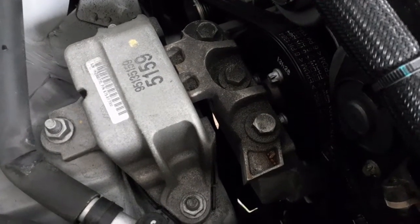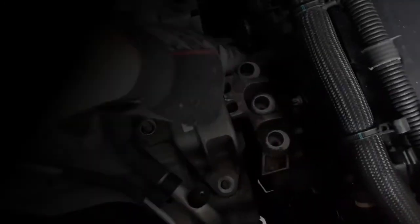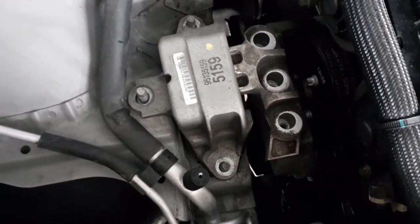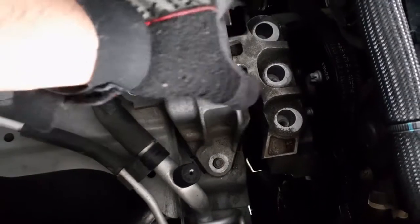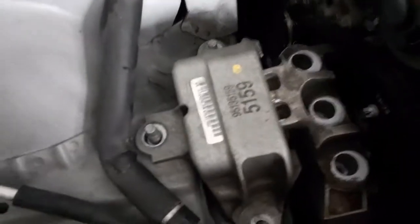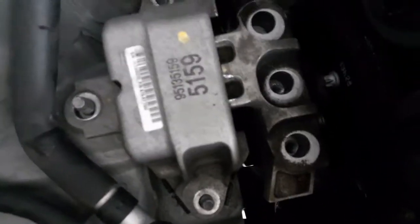Let's go ahead and just knock this out. The three nuts are off and the three bolts are off. Just so you are perfectly clear, these are 15 millimeter bolts. What I suggest: you can remove the nuts and remove the two side bolts, but leave the one in the middle in. Slowly start going, and you may see a little jiggle in the engine — remember your jack down here. Give it a couple little pumps up until this is flush once again. It's pretty flush — I could literally just go ahead and bolt it in.